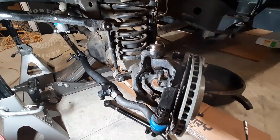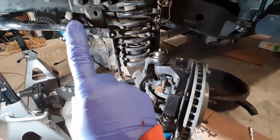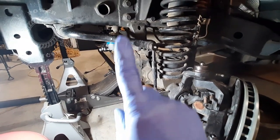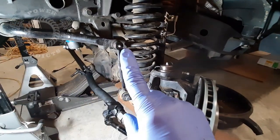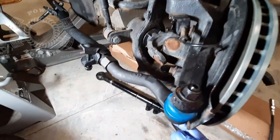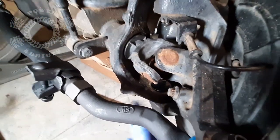Okay, we're on the driver's side. Let's go over real quick where they're all located - as we go through the video you'll see them in closer detail. Start out with the pitman arm right there, which comes off your steering box. It comes down and you can see the grease fitting right there. You got one on the end of your drag link off the pitman arm, upper ball joint right there coming off your sway bar - grease fitting there. Come down here, you got your tie rod right there, but wait - that's not a grease fitting. The grease fits down here at the bottom. Oftentimes you will have one on your lower ball joint as well - these do not have it, but more about that later.